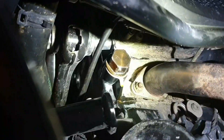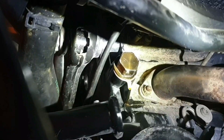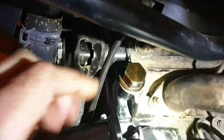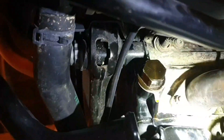I've put the hydraulic plunger back in for the cam chain tensioner. To get this back in you basically have to lie on your back on the floor and press on the end of the nut with one of your thumbs, because you've got to depress the spring-loaded part of the plunger. When this unscrews it kind of pops forward, so be careful and be ready for that — keep your hand over it. Then with your other hand, carefully re-engage the threads on it.